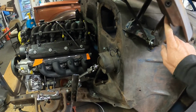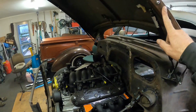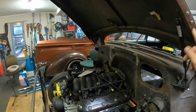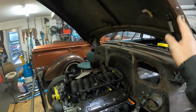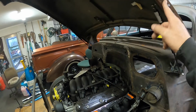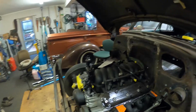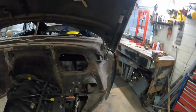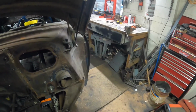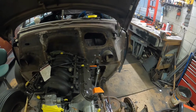and then that had to clear that thing up in there, and then had to make a bracket to hold it in here. Didn't want to use the existing holes because I don't know what goes in there, and I might need those holes, so I wanted to get it off to either side of that, and it worked out about, I don't know, 50mm centered away from that hole. So that's that. And as you saw if you watched the whole video, I folded up that little piece there and then made those little bits there, welded them on and bolted all together, and it works surprisingly well.